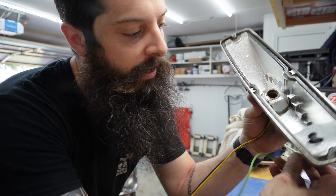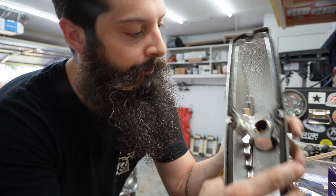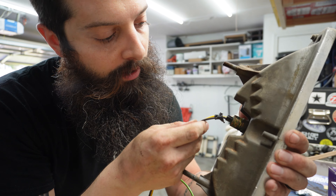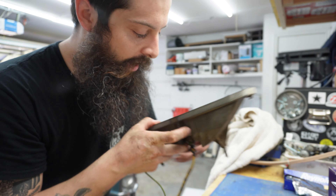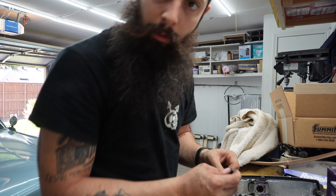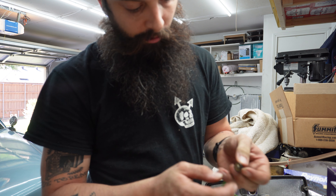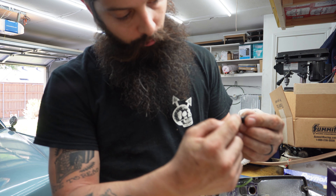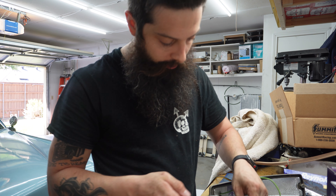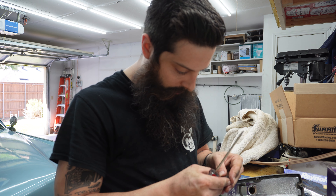Here's the deal. This guy went all the way through. This guy here, I clipped off this plastic piece, which was, I think, what was gumming up the springs. And now if I stick a bulb in here, it's good — there's enough pressure on it. I think what happened is this spring for this 1156 doesn't want to pop back out. There's actually corrosion in this boot and it's grabbing the wire and not letting the spring return. Let me see if I can just...